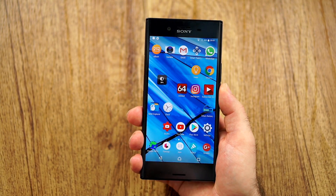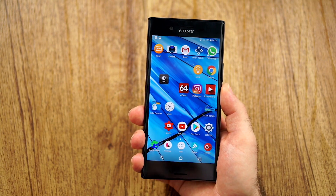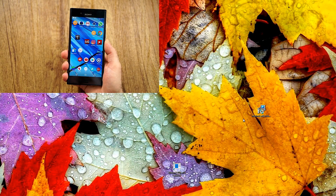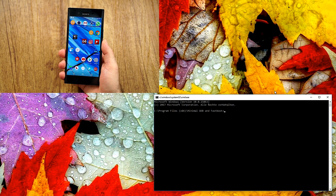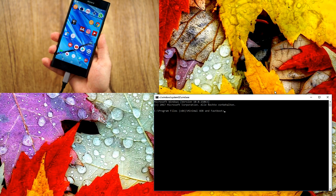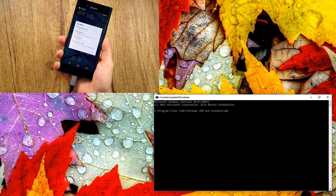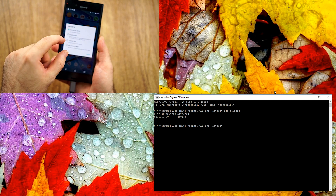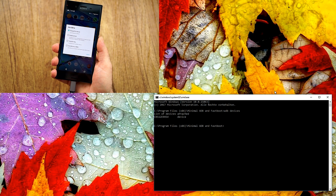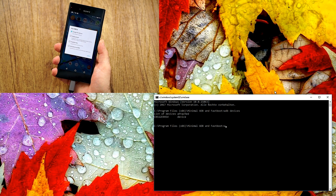So how do you install this? What you have to do is launch and run minimal ADB fastboot, as you can see here. You can just install it — this is pretty straightforward and a really easy process. What we have to do now is plug in the phone and then type in, for example, 'adb devices' so we can see that our device shows up. What you will usually get is a pop-up asking if you allow USB debugging, which you of course have to enable in the settings first.